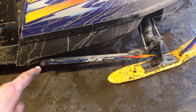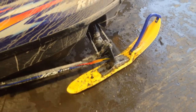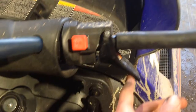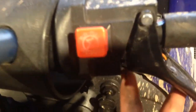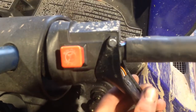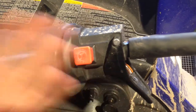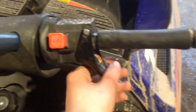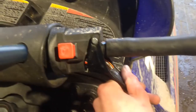These things always cause trouble when you're doing lots of jumps and wheelies, because those bolts like to break, as well as the trailing arms right around this area when you hit hard. If your machine doesn't want to idle, it might be your throttle. You see when I have it like this, there's a little nub right there — that's a sensor that has to be in at idle, or else the thing won't idle. It's a safety so if something gets jammed in there it's supposed to shut the thing off so your throttle doesn't get stuck wide open. But if at idle it's not sitting correctly, the motor will die.